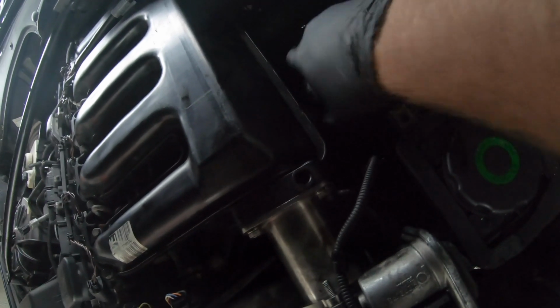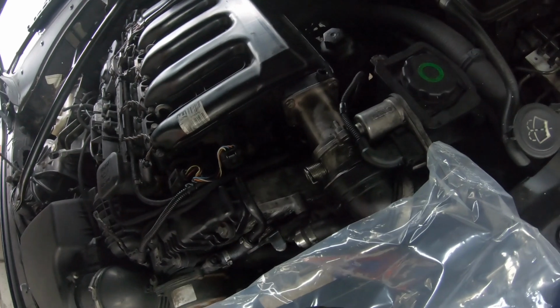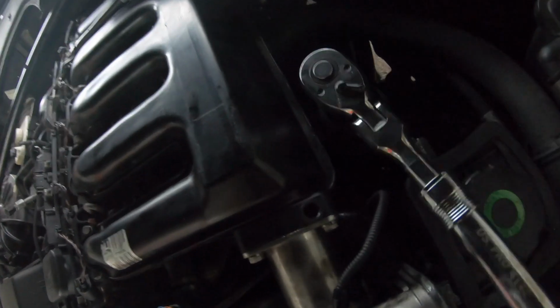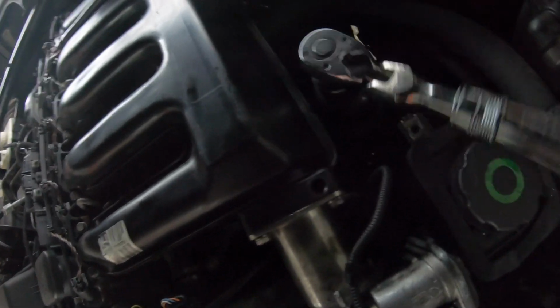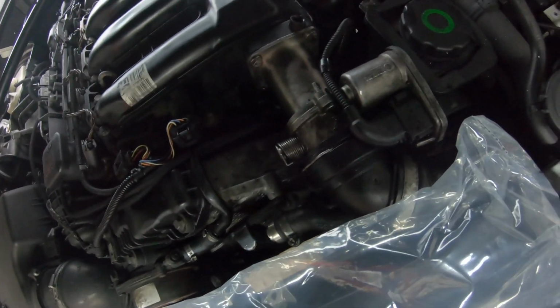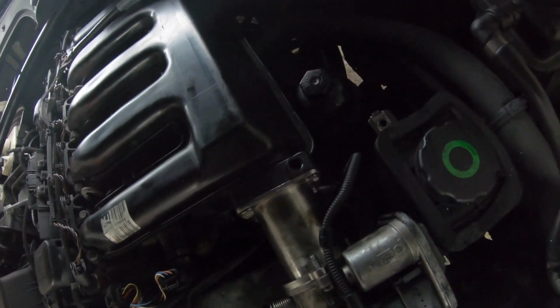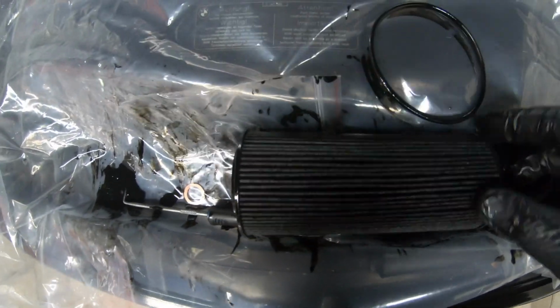like that. And you just want to tighten it back down, which we're going to do. We're going to turn it back down like that and tighten it back down until it's tightly fitted, and done. So as you see there, you don't want to put too much pressure on it. That's your oil filter changed on this car and back in the oil filter housing. But you've seen how black this one was. This one is really black and it just hasn't been changed for ages, so I'm glad I actually changed it.